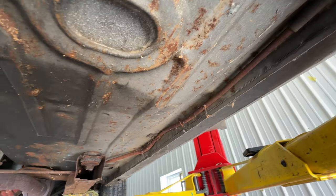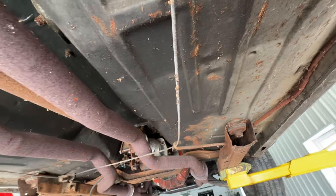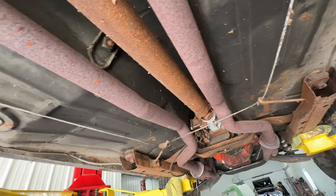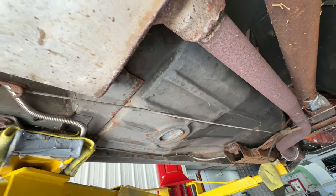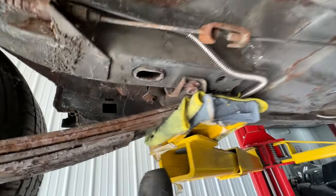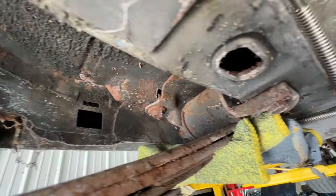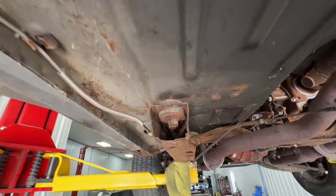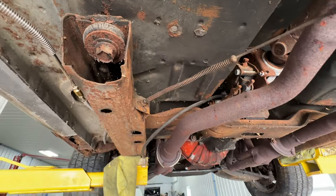If you look at the floors, they've got some surface rust on them but there's no evidence that this car has been cut apart and floor patches put in place. Looking over at the back of the rocker panels, it's really clean — this car did not get real rusty on the bottom, which is great. The subframe bushings are shot, which is to be expected, but I believe the subframe could probably be just media blasted, restored, and reused once again.